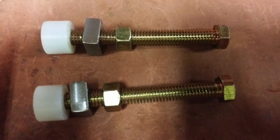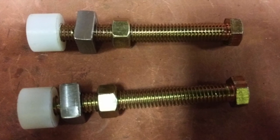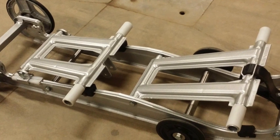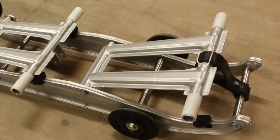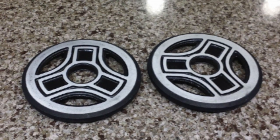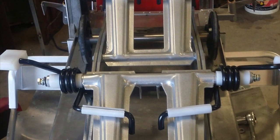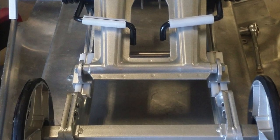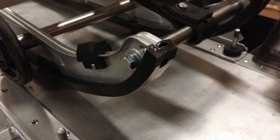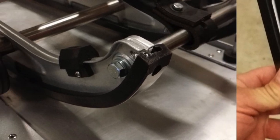The skid was a fair amount of work. I had to get a lot of new fasteners and manufacture some new rods to go across from each slide. I redid the wheels, painted them, and clear coated them. I made new wear tubes to go on the end of the floating arms, and got new slides. Everything was redone on the skid.